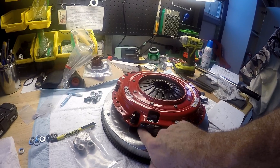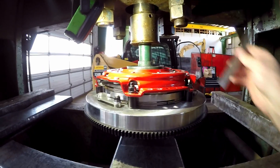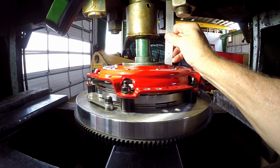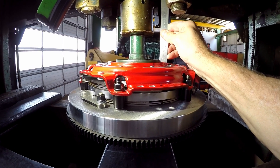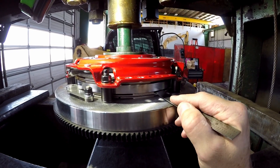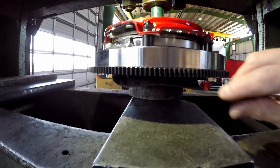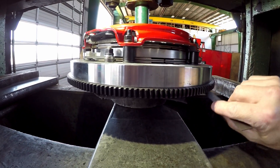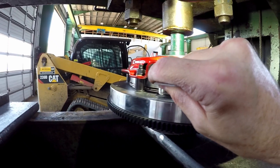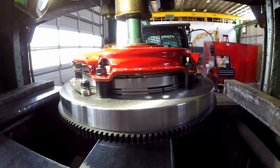That's another video. When we push down on this at least 400 thousandths — it'll actually push down more — we want to get complete disengagement. Here at the press, this is a pressing block under tension. We started out with this edge at 500 thousandths and we've only pressed it down 300, and we've already got movement on the frictions — I can spin these without any problem. I didn't want to press supporting the sides of the flywheel since it's already precision ground, but we should be good to go — we know it's going to disengage.